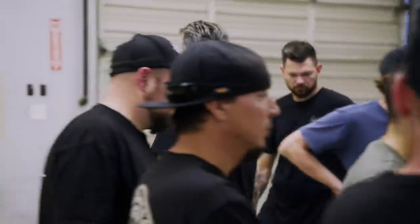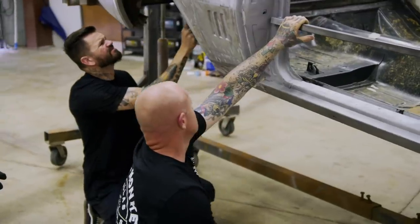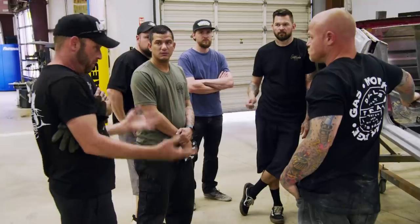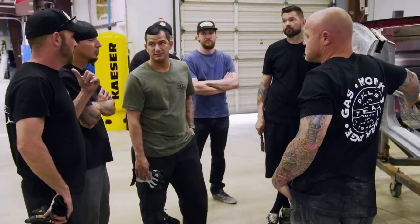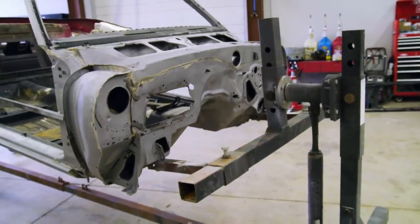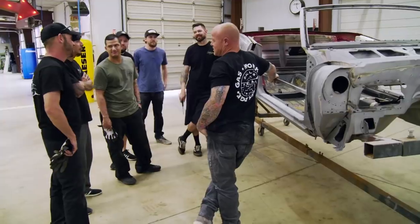Now you all got a week — seven days — to get it done. I got to meet Dennis to see a man about a VW van. The quarters are still kind of rough. We don't have time to replace them. The plan: you and Jeremy tackle the wheel tubs, do all the prep work before it goes to paint, put the suspension on so you can set your doors and fenders. With a convertible, that's the best way to block the car. We decided we should add subframe connectors — simply because the Butler is a 600 horsepower motor. It's going to have at least 550 at the rear. All that horsepower is going to make the car want to twist and flex, especially on a convertible. Subframe connectors will connect the subframe to the unibody to stiffen it up and make it handle way better. Too bad we've got a badass Butler motor for a convertible — top goes down, price goes up. Let's get this thing started.